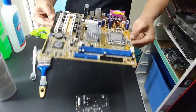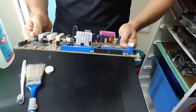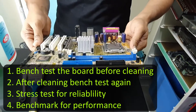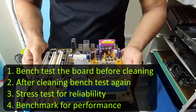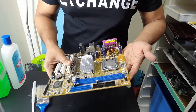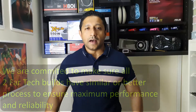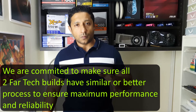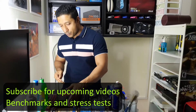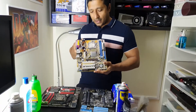So here is a very basic cleanup that I've done quickly. Normally I take more time, go into the details of each chip and clean them, and then I test them. I would bench test with just the processor and cooler mounted for a few hours to see if it's a stable system and the cleaning didn't cause any problems. Typically I bench test before and after cleaning to confirm it's a successful project. I understand my video about the motherboard is pretty long, but it was really necessary to explain the reasons why I do things a certain way.